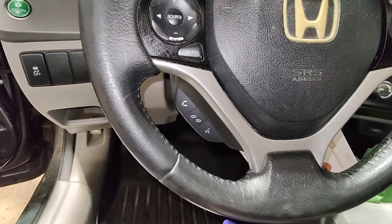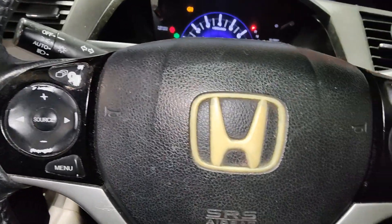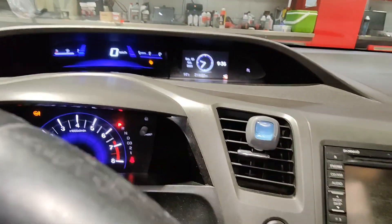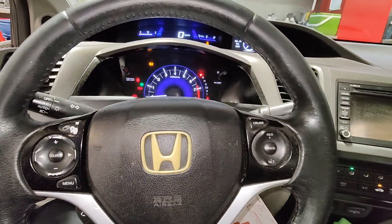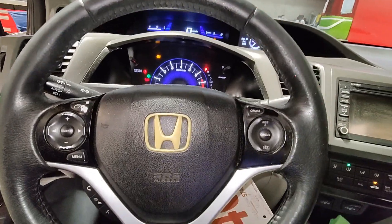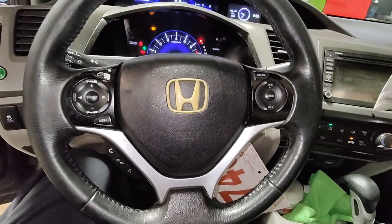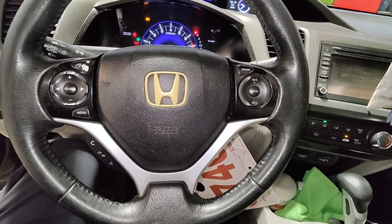The last time this car was here it had about 88,000 kilometers, and that was quite a while ago. Now it's back — I guess all they do is oil changes. The sticker is pretty faded but I can see it says 217 for the next oil change, and right now it's at 214. He's not super overdue, but you can't help but inspect things, especially when the RO says no inspection. I noticed the drive belt and also a rear left brake light out — stuff like that. You tell the customer and yeah, they end up doing it, even though they didn't want an inspection. You just can't help but look sometimes.